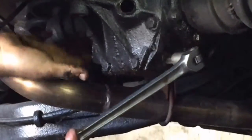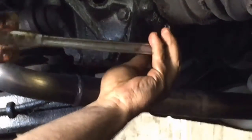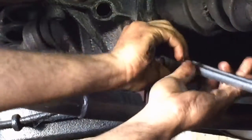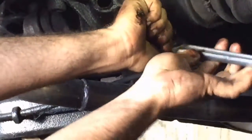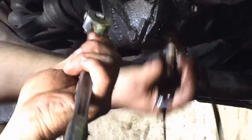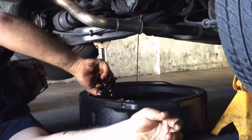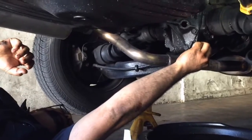The style of differential that uses two independent swing axles or CV axles will almost always take 1.1 liters of fluid. And if you have a limited slip differential, be sure that you put the correct Mercedes-recommended limited slip oil in it. Now look at that — isn't that gross? Most people never do this job, and a lot less than one quart came out of there.